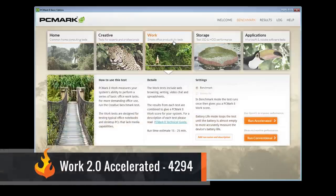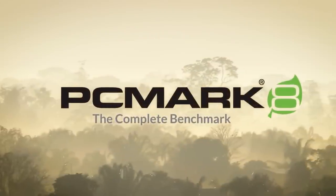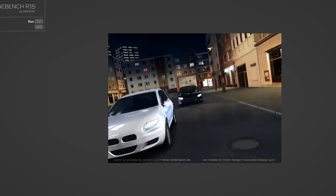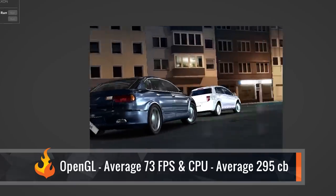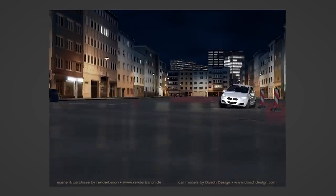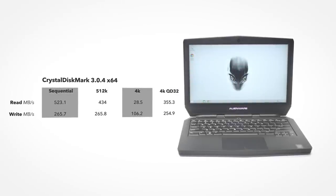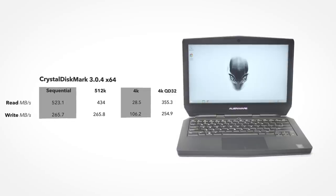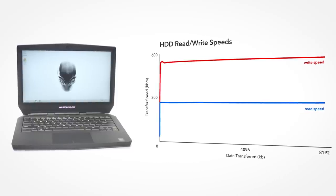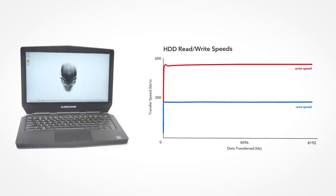For general gaming — which is heavy GPU and modest CPU usage — it performs very well and compares to a high-end gaming laptop from two years ago, packed into a slimmer, lighter product. For a GPU-accelerated video encoding test using Cinebench R15, the Alienware 13 performs well, better than many desktop setups, but has a relatively low CPU encoding score — a high-end desktop with an i7-5960X would perform four times better in the CPU encoding segment. Hard disk performance, tested via CrystalDiskMark 3.0 and Atto Disk Benchmark, shows very good medium to high-end SSD performance, with the option to upgrade to faster Samsung NVMe M.2 drives.